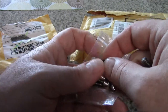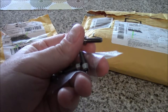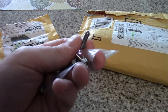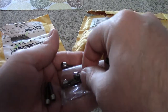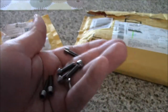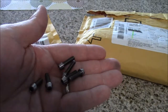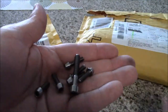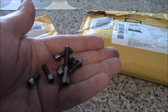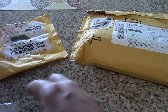With the titanium bolts you're going to have to be very careful with your torque. Make sure you use the torque spec, which is 5 newton meters for your headset. In the next video I'll do a quick installation — I should upload that today as well. I'm going to do this video to show you these and then show you the installation as a do-it-yourself.